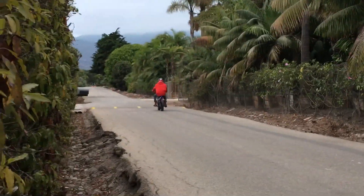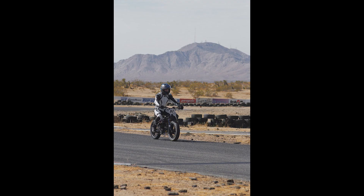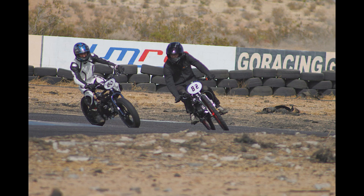That shift point is based on the setup of the second-gear clutch. You can manipulate the shift point based on the weights and spring you put in that second-gear clutch. We took it to the track — number 82 is a 212cc bike — and we're really proud that we were able to hang with that 212cc bike.